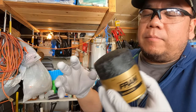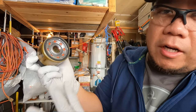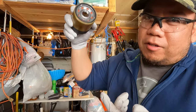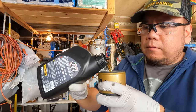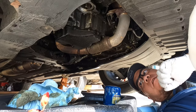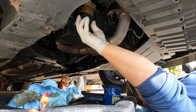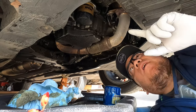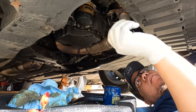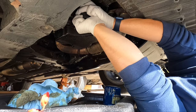The Fram's are not the best, but like I said, it's literally the only one that I had. Oil the gasket here. Some people like to pre-fill. I've never done it before because all the cars that we had were either cartridge-based or to the side — it's just going to come right out. I'm going to go ahead and pre-fill it right now. Get some of the oil and then you kind of just moisten that new gasket. All right, we are back here — got our new filter, just pop it straight back up and in. Once it's on and it gets tighter, you go about three quarters to one extra turn beyond. I do want to make sure it's good. I think we're good there.